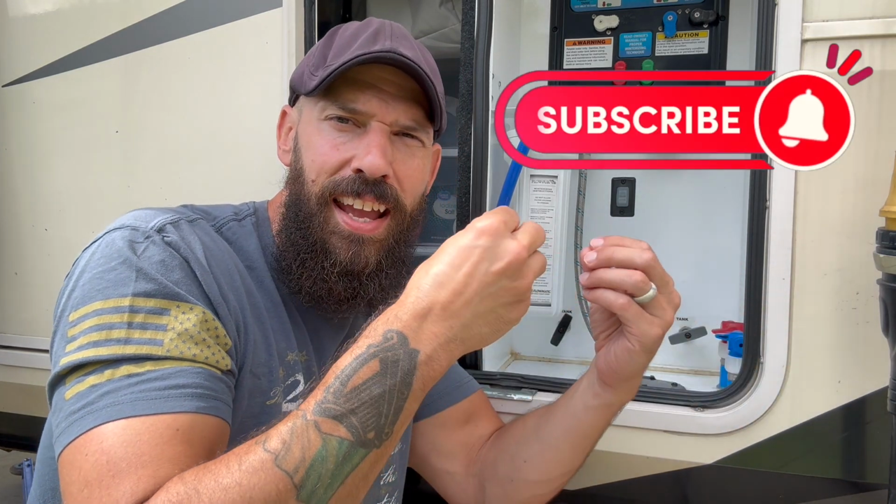Now, I've actually had to open one of these up before. It's literally just 4 screws, and you're going to basically just unscrew it, and that gate valve is going to come off. You can actually take it out, clean it up if you need to. Sometimes you can just take the gate valve and clean it up. We had our kitchen gray tank full of oily residue and basically just gunk over time from grease and stuff like that. And I was able to actually go under there. They're usually located at a pretty easy spot where you don't have to drop the whole coroplast. All we've had to do both times is just open up a corner, and you can take that gate valve out, just pull it out a little bit, clean it up, clean the pipe right there, and then put it back in.